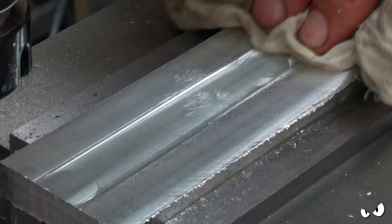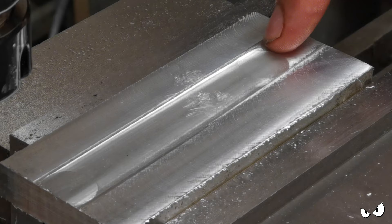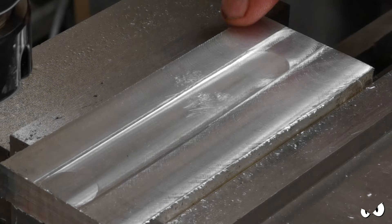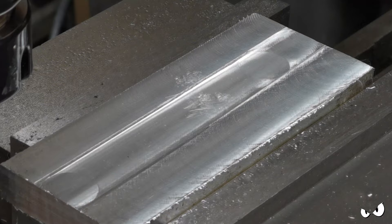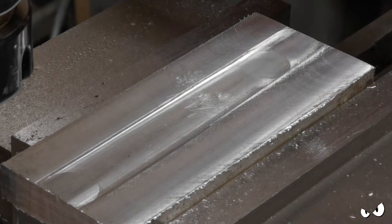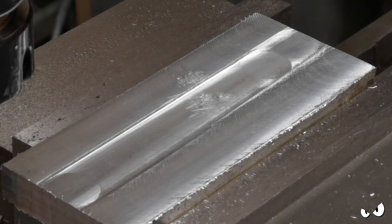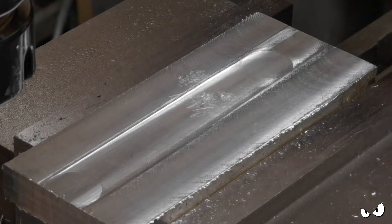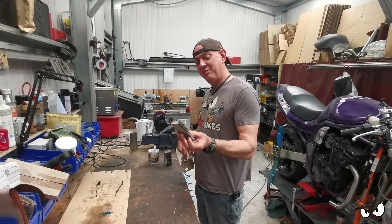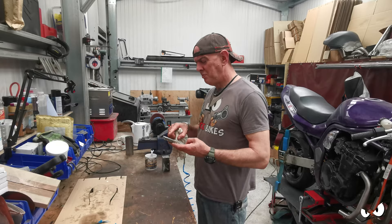Let's have the top off, tweak the bearings and give it another go. This is the next attempt - all I did was tweak the bearings up a tiny tiny tiny bit. This pass here is way better than the first one. I also stopped at the same place and as you can see I'm not getting the same sort of imprints, and I'm not getting the swirls that we had when drawing back over the material. The bearings have definitely done the trick - edges are really sharp. I also had a go at side milling and getting a much much better finish, although it's not absolutely dead flat because I've got play in my gibs on Y. But the finish in both directions is so much better than what it was - I'm very happy with that. It's a really nice finish and you don't get all the little squiggles and stuff if you stop and start.